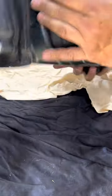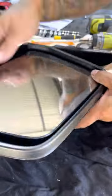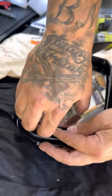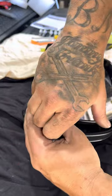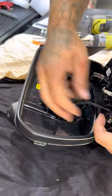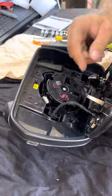Alright, driver side next-gen mirror. If you get your fingers under this corner of the mirror like so, hold it and just firmly pull up — you'll be able to disconnect the heater element.